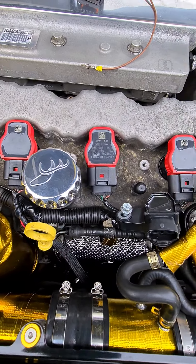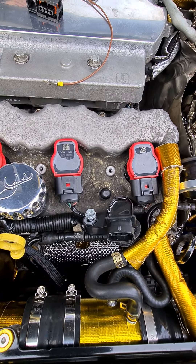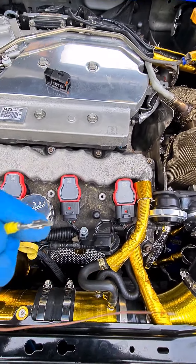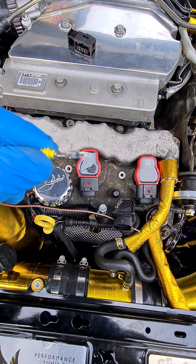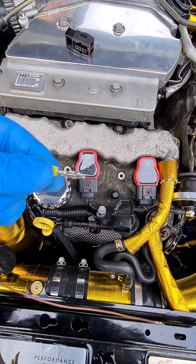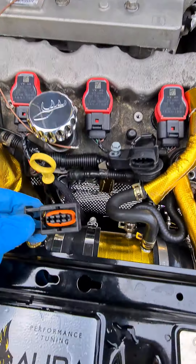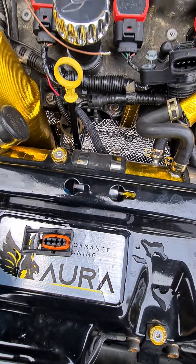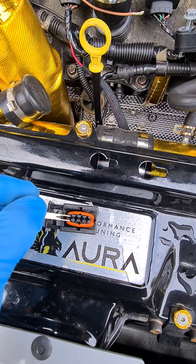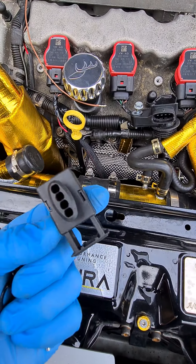I've used my original wiring and the pins are actually compatible with the Volkswagen plugs, though there are different Volkswagen plugs. I might put a kit together. When the pin is inside the casing, you have to release it with a special tool to get the pin out without damaging the wiring. I bought a little two-prong tool off eBay — it goes in the hole, it's a little bit fiddly, and you have to do a bit of wiggling around, but they do pop out.